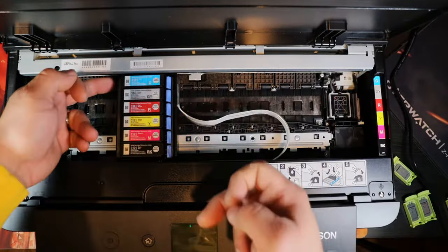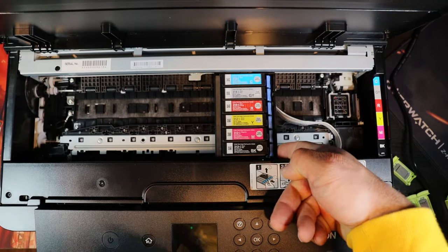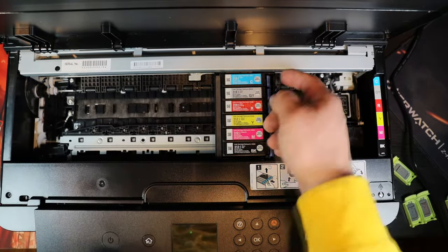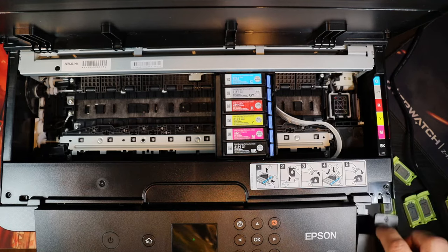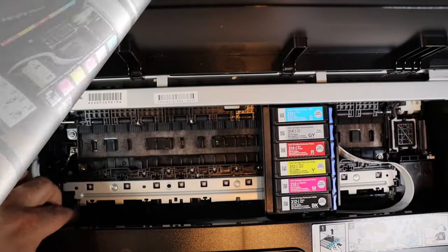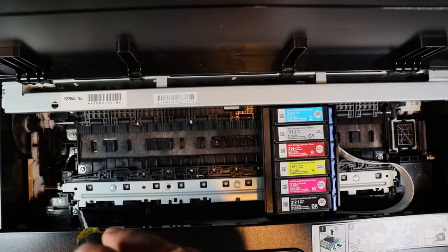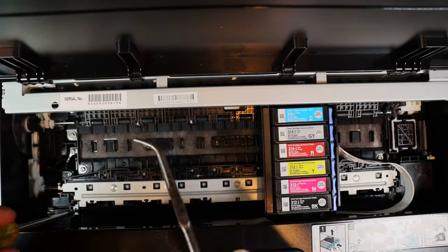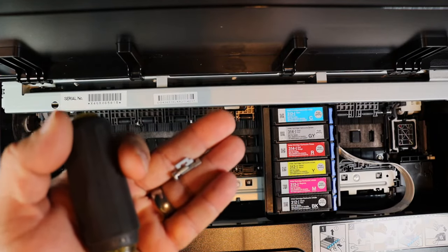Put pressure here to move it to the left or to the right. Try not to grab it here because it kind of binds it — if you push there it doesn't go; it actually binds the print head and doesn't let it move. When you move it, you want to move it always as far back on the carrier as possible. So we're going to grab our flat head, go in an up motion, remove this cover. Now that's going to give us access to our waste tank. We're going to grab our Phillips screwdriver right in here — that screw that I am touching right here is what we're going to remove, and we're going to do the same right in here. You're going to see a little metal clip and a screw, and we're going to be removing that on both sides.